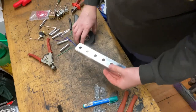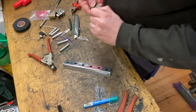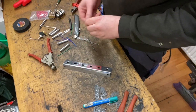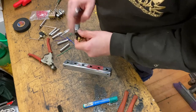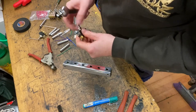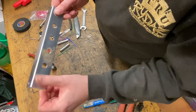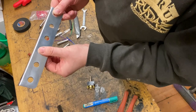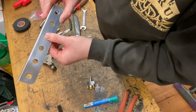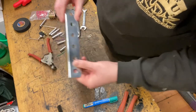Now what I like to do is assemble the switch panel exactly how you intend to. So spanner, 14, 15 metric tends to do the business. The plan is to run front switch nearest the door and the back switch, and this is going to be all up and all down. This is going to be left side and right side, and this is going to control your 4 dumps.